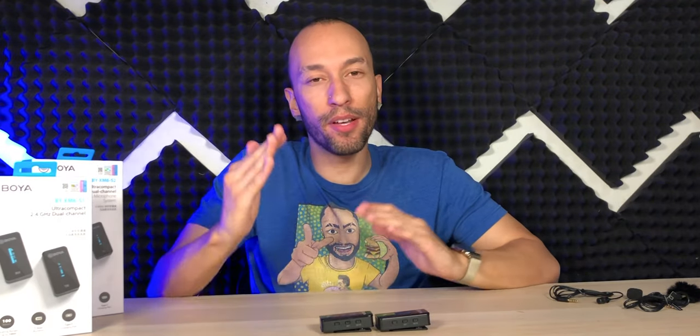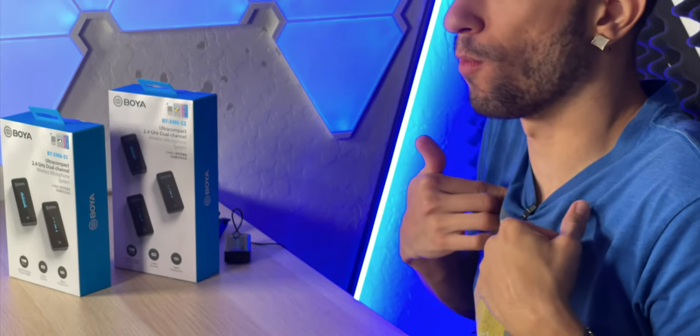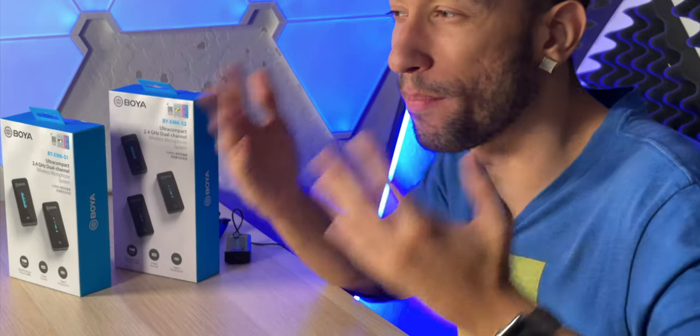So now we're going to actually put this thing to the test inside the studio right here. We are switched live to the audio coming directly from this lavalier microphone that I've clipped onto my shirt — how I would actually be wearing it in the real world if I was doing an interview. It's coming through with a gain of 5 right now, which I feel like is where I'm going to leave it. With other brands that's exactly where I leave it, because 6 sometimes peaks a little bit. 5 is usually loud enough so you can adjust it afterwards, but not too loud so it peaks while you're using it — unless you happen to be screaming.